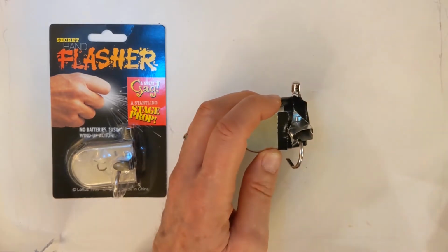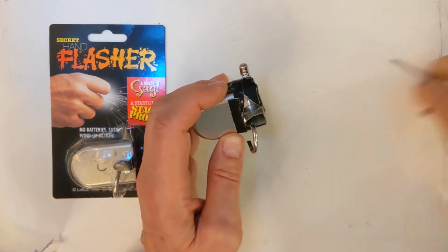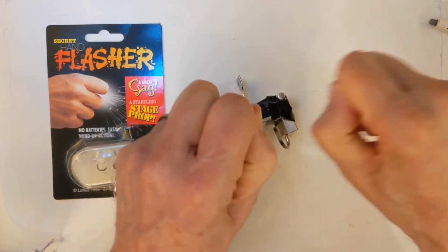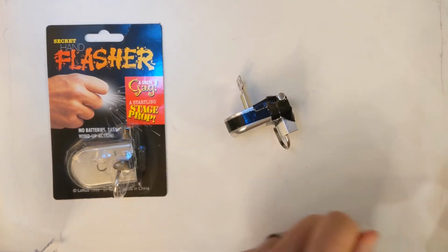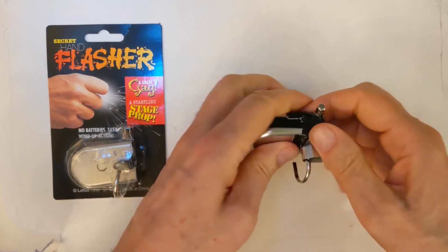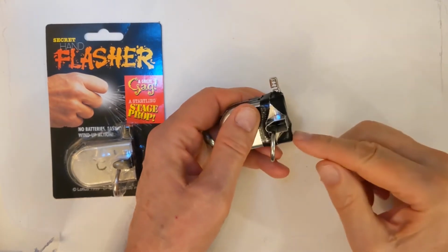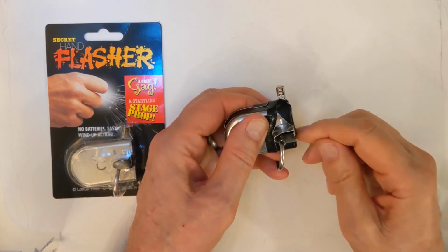So what I did is I removed the little metal spring. I had to untape the tape and all that, get the spring out, and literally stretch it with my screwdriver and my pliers to make the spring a little bit longer. Then I put it back in, so it has more upward pressure, and that little metal tab is fitting more tightly against that abrasion wheel.